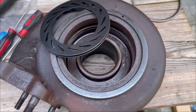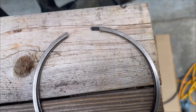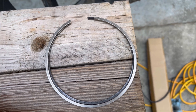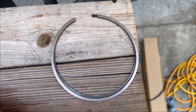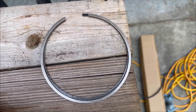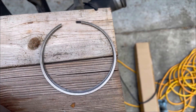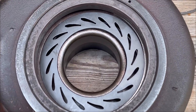We're running into some issues with the ring. Looking at the snap rings: the darker one on the bottom is the OEM one, the one on top came with the nozzle ring. They are different sizes when uncompressed, but when compressed they equal the same size. I don't know if the OEM one is just fatigued and crushed down from being in there for years and a quarter million miles, but we're still going to try the new one. When we compress the springs together everything lines up perfectly when fully closed, so we believe it's just a fatigue issue on the OEM one.